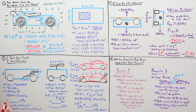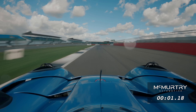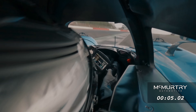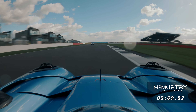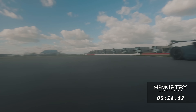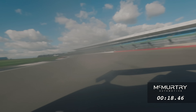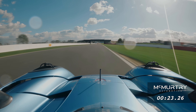Using a conservative estimate of the full 60 kilowatts of power to create that downforce: 60,000 watts divided by 2,000 kilograms gives us an efficiency of 30 watts per kilogram of downforce created. One of the beautiful things about this solution is that it allows your car to have a very aerodynamic shape, because the shape of the car isn't what's creating the downforce — that's done with the fans. So you can have more energy saved by having a very efficient car shape driving at high speed, with more energy left over for power or range.